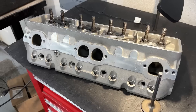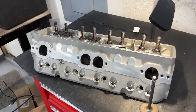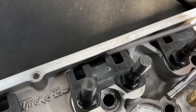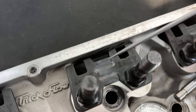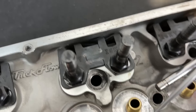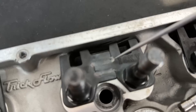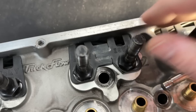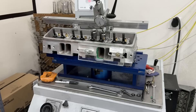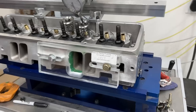I'm going to flow it on a 4.155-inch bore plate because that's what you'd probably use — with the 2.08 intake valve I don't have to worry about shrouding, although the chambers will probably overhang. I'm using a Brzezinski 1207 entry with modeling clay to close it up. I also have a 1206 entry, but the 1207 is actually slightly bigger because they made the wall thinner — giving the head the best opportunity. I used the same entry for the AFR 235 and Brodix Track One 233 to keep it a level playing field. Also, the previous owner correctly installed adjustable Isky guide plates, which is a smart move.